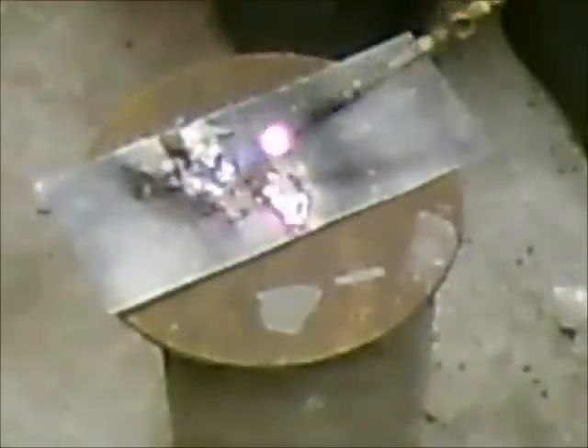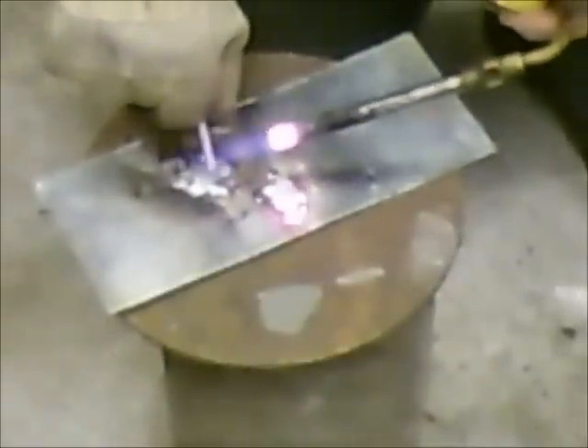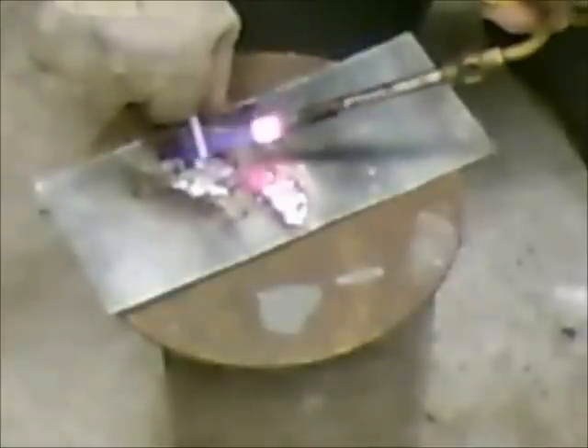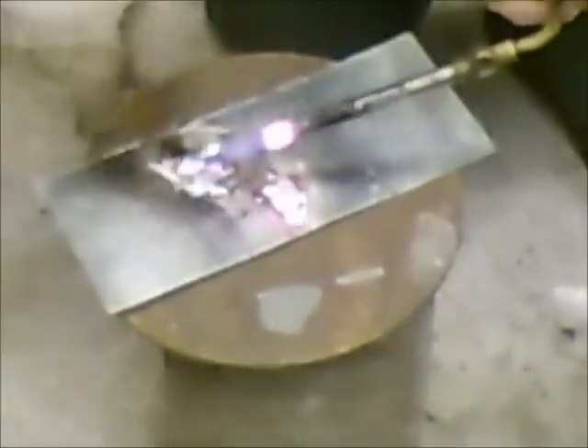As you can see, it melts quite a bit faster than the lead-free stuff. And I think that's one reason a lot of guys like the lead better because it's easier to work with. But it doesn't have a way to help with the health risk. So anybody that is going to be trying this, I would definitely recommend go with the lead-free stuff, particularly if you've never done it before. I don't think it's going to be too difficult to learn.